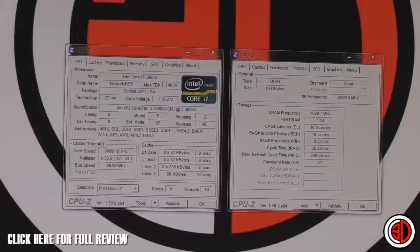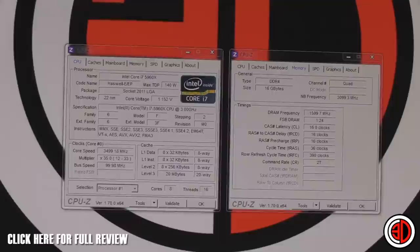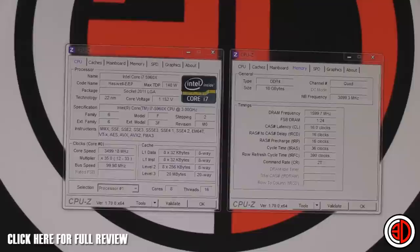With the other stuff we've done before it's been above that — I haven't done anything below 2800 MHz. 2800 MHz has a 127 base clock, 3000 MHz has a 125 base clock. The tie-in for 3200 MHz is actually 100 — I was under the impression that anything at or above 2666 was always going to be a higher BCLK tie-in, so this is all news to me. This is also going to affect the graphs, because very few of our tests purely test memory — if the base clock is different, the benchmark will respond differently.